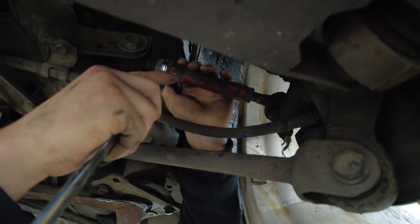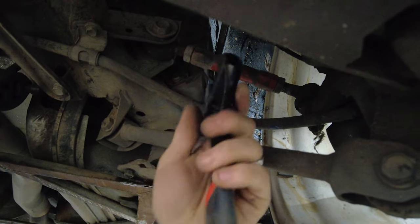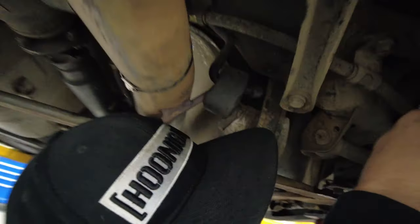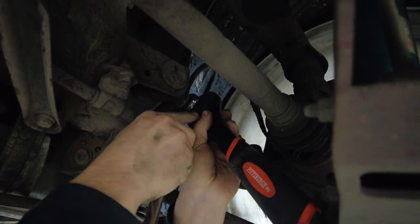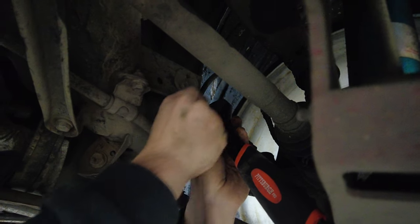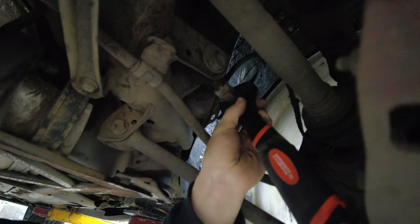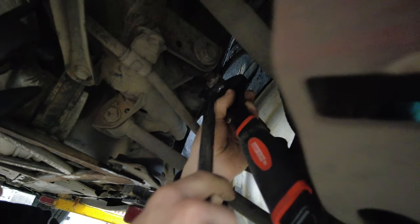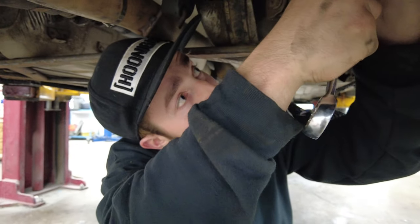So you're gonna get your lock nuts tight. You're gonna hold the thing. These are just 4 inches of the best. I'd get a set because it saves you a lot of hassle at the track. But a good set of sharp, nice blue point wrenches to break them and tighten them are kind of nice, because they're not gonna slip off and you're not gonna punch a control arm, because that sucks. Yeah, so that's how you do it. And just make sure when you're tightening them that it doesn't spin. Obviously this isn't perfect, but this is the best way to do it.